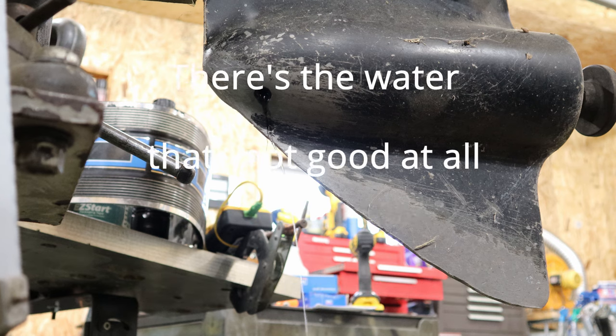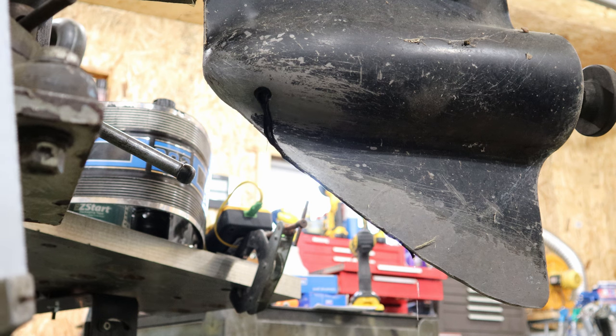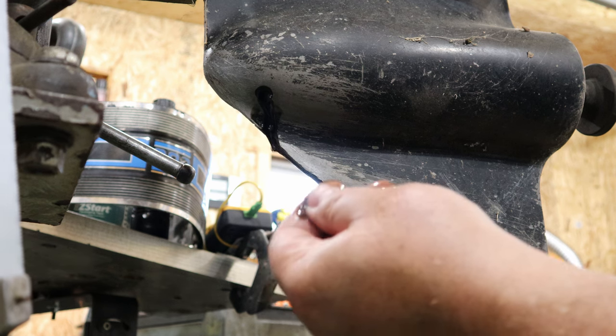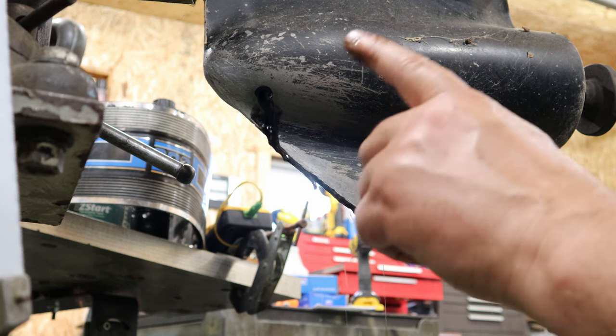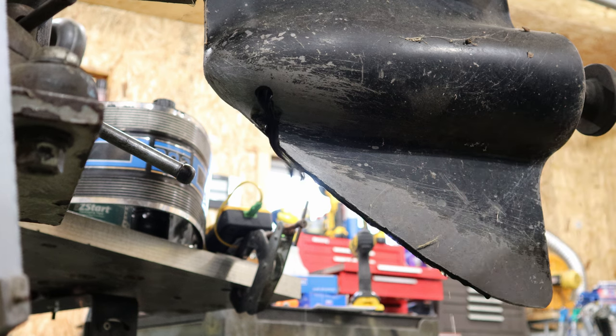Well, there came a little water — that's not good. There's a little water sitting in there. This is a very interesting combination of oil and I'm seeing a little bit of water coming out intermittently with the oil. Usually water comes out first then oil. This one's got me puzzled — could it be condensation? The gear oil actually feels really dark but it feels good. I've had oil come out pure black on my other boat that I ran 200 miles on and it broke down the oil a little bit.